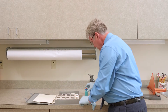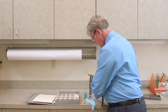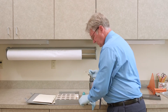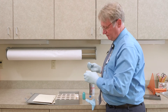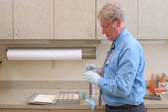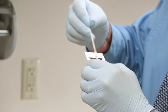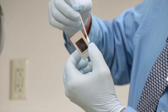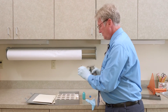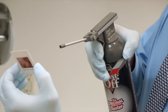So what we're going to do is take our alcohol and get our swab wet. Now, you don't want to dip the slide directly into the alcohol — that will harm the slide and also might harm the case. So we're just going to wipe it off. We're using alcohol because it's going to evaporate very quickly. We're going to wipe horizontally, then take our compressed air and hit that really quick, and that's going to dry our alcohol off.